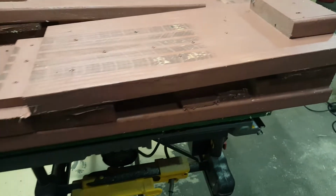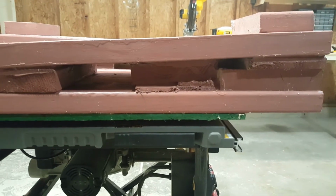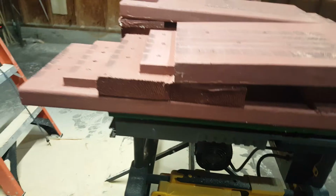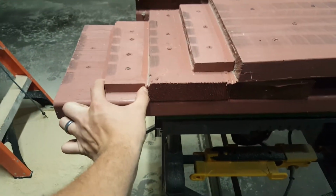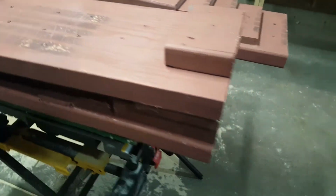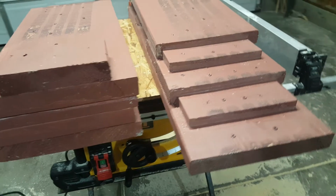This allows the last step to be gained and the final resting position and height to nearly be completed at an idle, rather than simply having another step and then immediately needing to stop before going too far. The transition is flawless feeling compared to the old steel ones where it's gas, gas, gas, hard brake immediately, which is not ideal if it's this easy to fix. I ended up with about a 6-inch lift at the ideal park point.